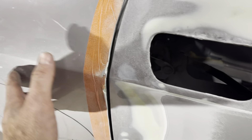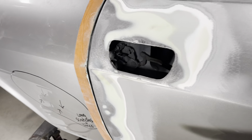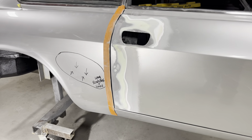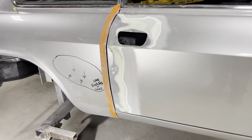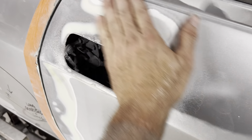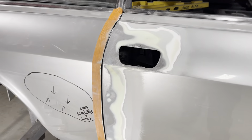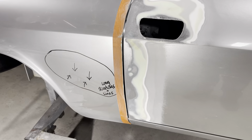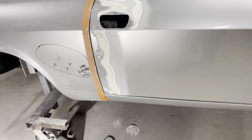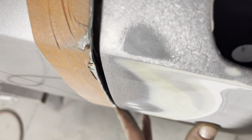We just don't need so much body filler on it, guys and gals — we just don't need it. Hopefully soon, the notion that more body filler is good will be flushed away. The proper way is to have as minimal amount of body filler as possible. Old-school stuff isn't always best — back in the 70s, lather on Bondo, call it a day, get the insurance payout and go home. Now, restoration work is a whole lot different and more involved than collision work, so collision guys aren't always the best restorers. That's my experience.